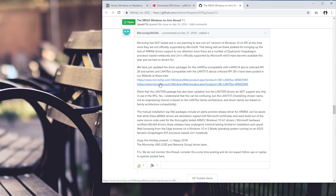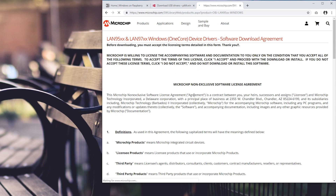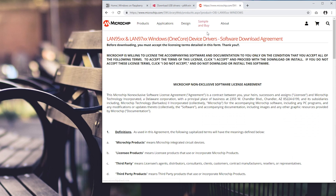Also head over to the GitHub link in the description below — that will give you the latest UEFI firmware drivers, which will be the January 2019 version. I know you guys had problems with it, but it's not a huge issue — you just have to change the boot order, and I'll show you that in a second. I also have a link for LAN drivers. We have both Raspberry Pi 3B+ and 3B. The 3B+ uses the 7800 driver and the 3B and below would be the 9500. Download the drivers you need for your version.